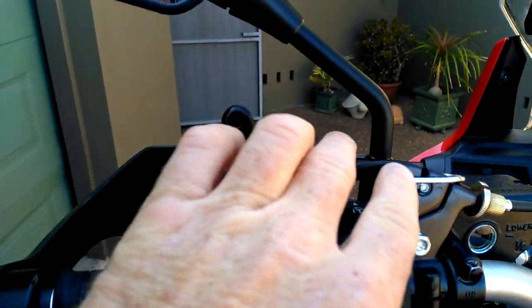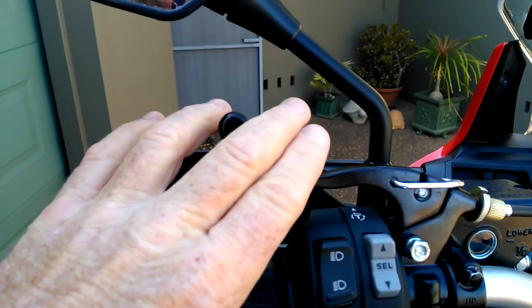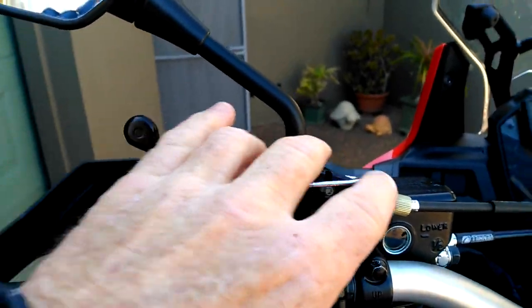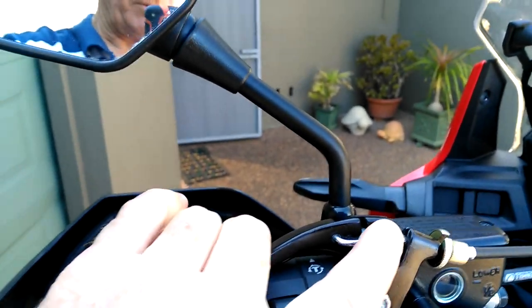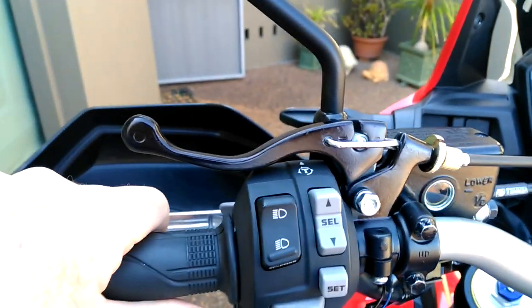I sourced another lever to put up on here — just a short lever for a park brake lever. So I have taken the park brake from here up onto here under the bars. To activate this, like I said it is a cable-operated job. Squeeze the lever, little barrel on here, drop the bar down and the rear park brake is engaged. The bike won't move.